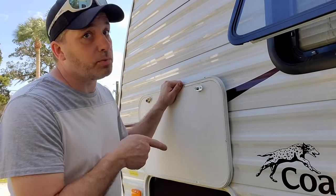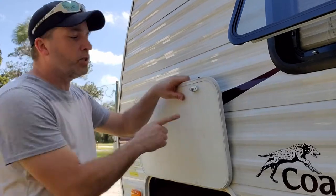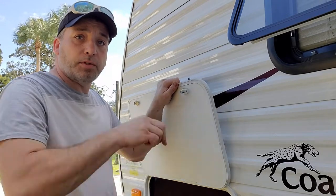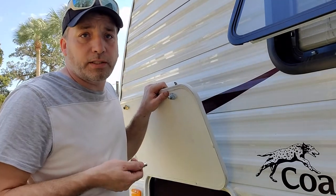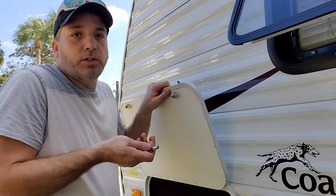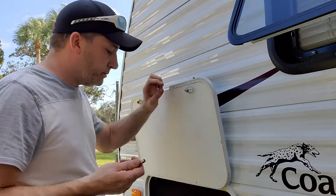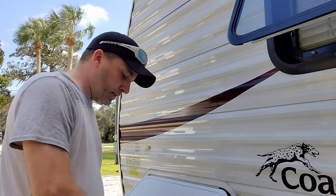That's number two down. We're gonna hit some of these other ones, then we'll come back and change these latch ones to locks also. Just a side note, that little cam thing you put on the back, depending on which way you flip that, determines which way it locks and unlocks with the key. So if you prefer spinning the key to the right to lock, you can put it on one way. If you wanna turn the key the other way to unlock or lock, you could turn it the other way. So you can play with that and see what works for you. I like to turn right to lock, righty tighty, so I figured tighten it, lock it up. So, works beautifully. On to the next one.